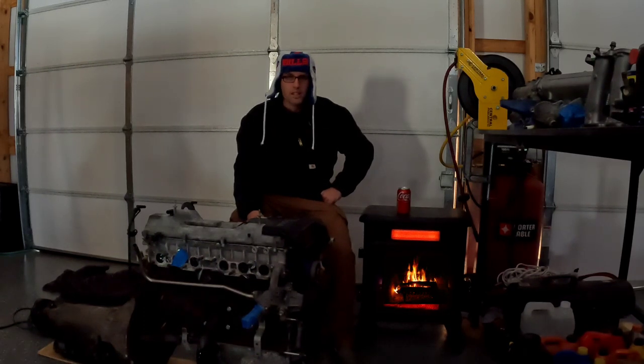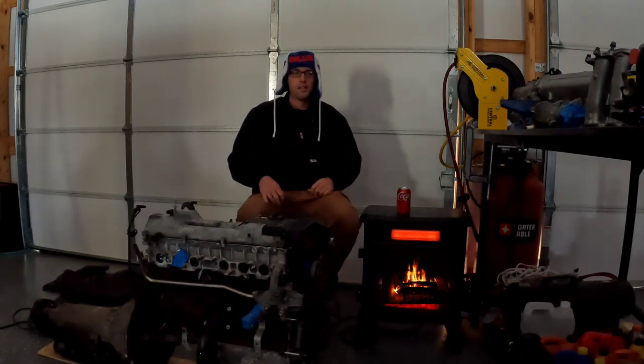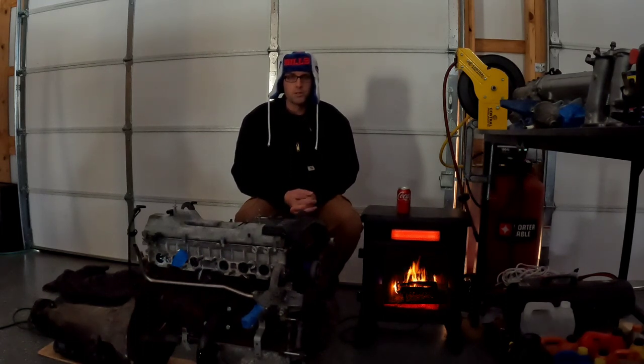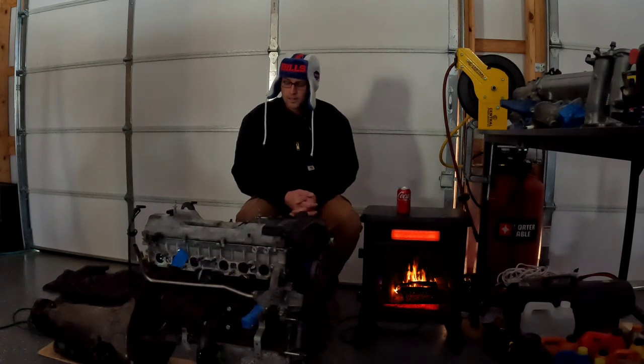Brought it home, and I'm sure you all have watched the videos on my channel about the car. If you haven't, go back and check them out. My buddy had already gotten some cool AMG wheels from the early 2000s for it. He'd already converted the KJet M103 engine to Megasquirt and he'd already done a lot of cool stuff to it. But basically the suspension was worn out, the brakes were worn out. So I went ahead and lowered the car with H&R Springs, rebuilt the entire suspension, rebuilt all the rubber, all the dampeners and the drive shafts, flex discs, diff bushings, all the brakes — everything underneath the car was brand new with the exception of the wheel bearings, because I was an idiot.